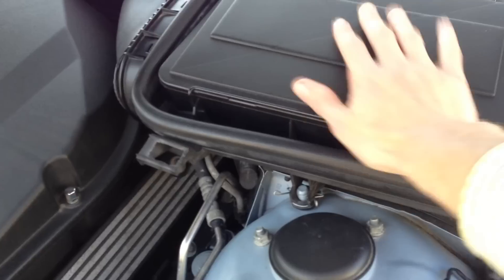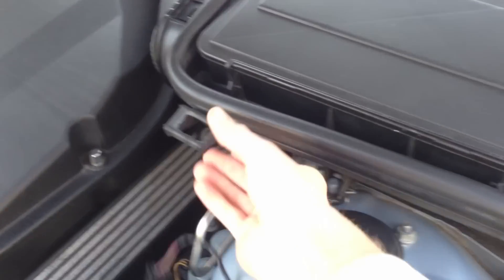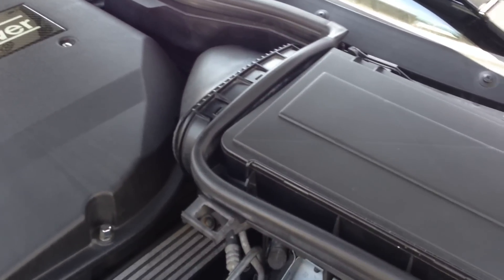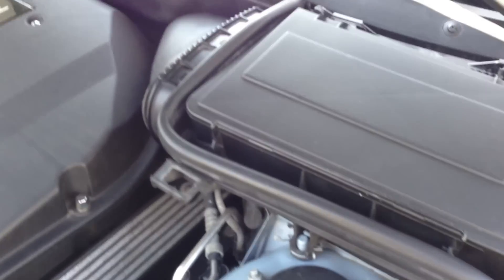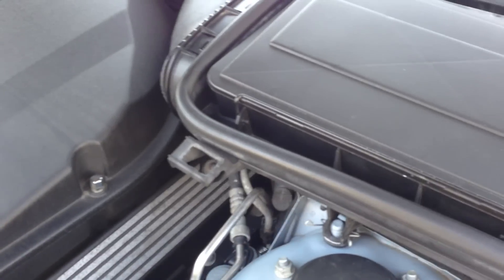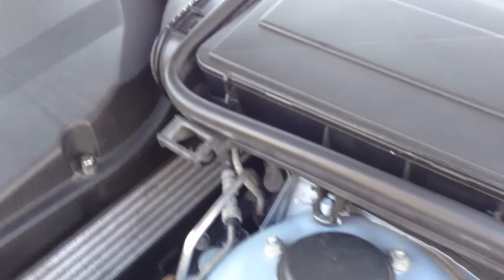There's a little bracket that comes off of this plastic bit, there's a wire that goes to it, and there's a sensor that lives right here. It sticks up when you close the hood, it hits the top of the hood and pushes it down. Those contacts can become brittle, something goes wrong with them, and it needs to be replaced. You could just unplug it — pull the wire out of the sensor — but then you're lacking the piece of hardware and any security that it does in fact add.